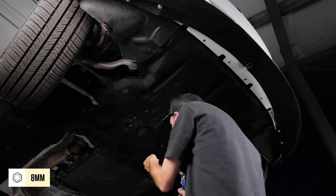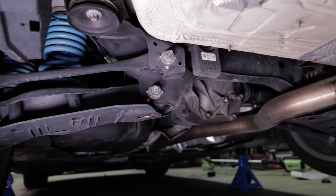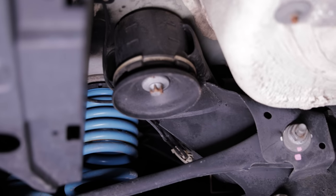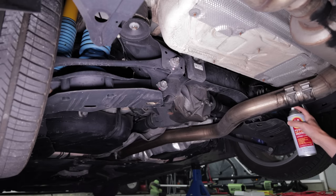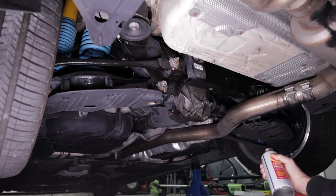Lastly, I'm going to be spraying the underside of the car with Fluid Film. As the name suggests, you spray this onto metal parts and it leaves an oil film that protects those parts from rust and corrosion. Luckily, the underside of BMW F30s is already covered with plastic paneling, but there are still exposed parts like the rear subframe, differential, and some suspension components. The car came from Florida and has never really seen a full Michigan winter — minimal rust so far, just a tiny bit starting on the differential. Spray this stuff on heavily, hitting parts from every angle you can reach.